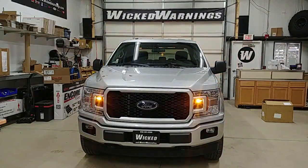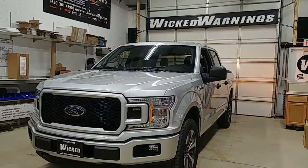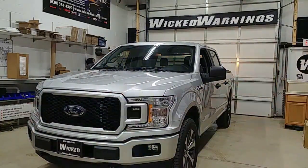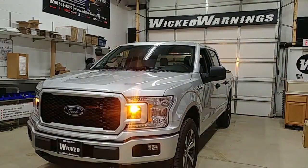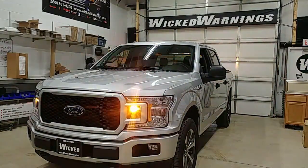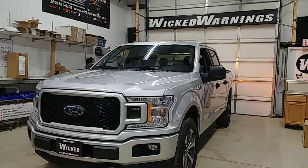There's a lot going on on the back of this truck, so let me show you one more version of the front. Here you can see that LIN-6 in the front grille — fits very nicely there, horizontally mounted. You can run the wiring right up behind the headlight, and we've synchronized both of them to fire amber and white together in an FPM 75 triple flash pattern.